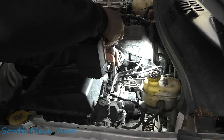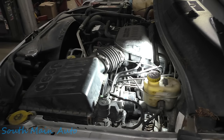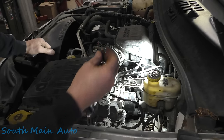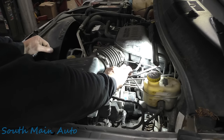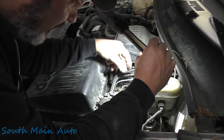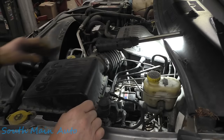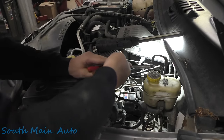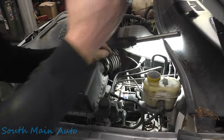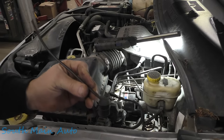Zip it zap. That nut. Out of there. There's that, she's an inverted flare. So we're gonna just stick that there so we don't get a bunch of junk in it. And then we're gonna go underneath this little guy. And get this line out of there, so we're not trying to yank through that curve of this line. Some old polycoated line, some old school stuff there. That was the next best thing before the Nicopp came out, was this green polycoated.